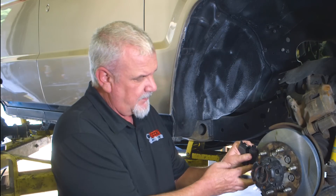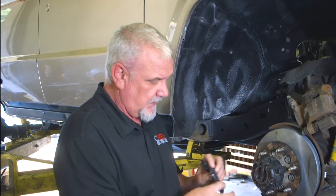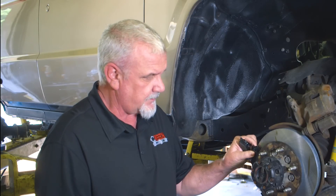A couple of reasons you may be having squealing noise from your brakes. One is if the brake pads are ever overheated for some reason and get a glazed surface on them — that can cause a brake squeal. The second thing will be if you have poor quality pads; that definitely can cause a squealing or squeaking noise.